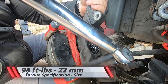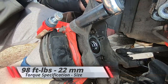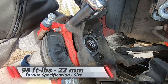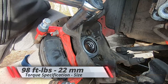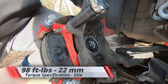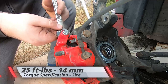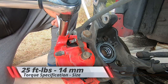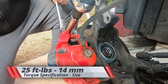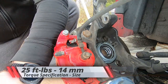If you're having difficulty tightening down to the full amount, you can mount the wheel hub back to the struts and put the two bolts in place just to hold it still enough so you can tighten it. I didn't have to do that in my situation, but you can. Now on to the caliper — this is going to be tightened down to 25 foot pounds using a 14 millimeter. Don't forget to use blue thread locker here.